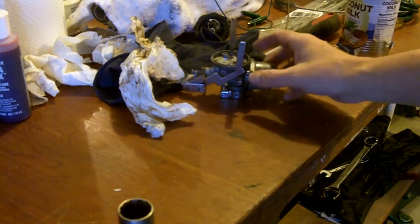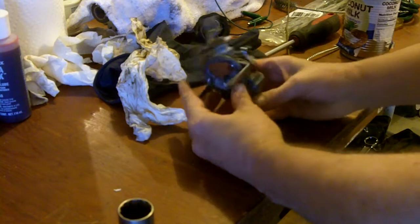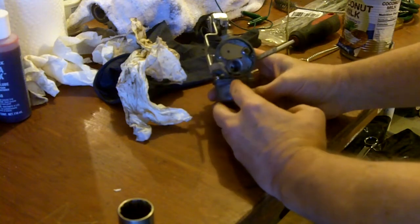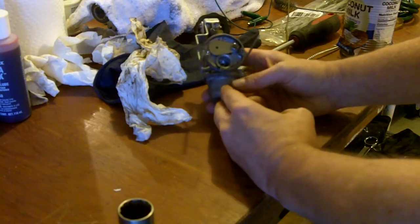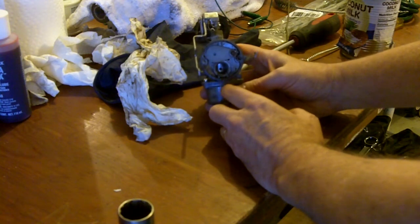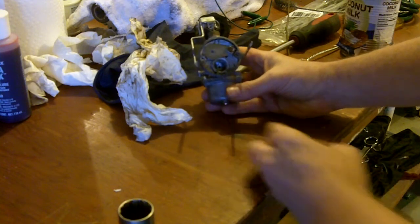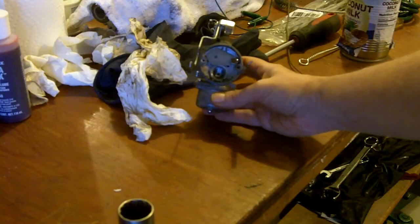We put the carburetor back together, hooked up the fuel line, and the fuel bowl overfilled into the throat. So we know that the needle valve inside is not working properly, the float is not shutting off, so we're going to have to open that up. But we're out of time this week, so look for that in our next video.